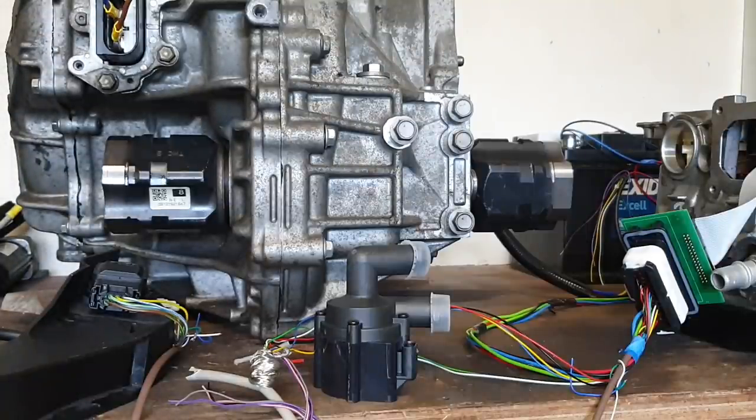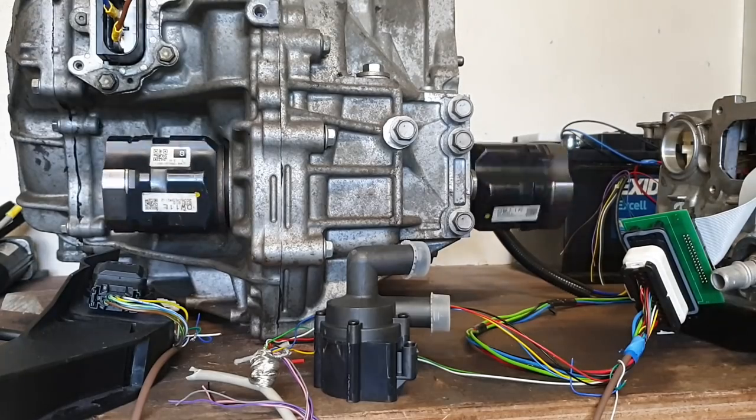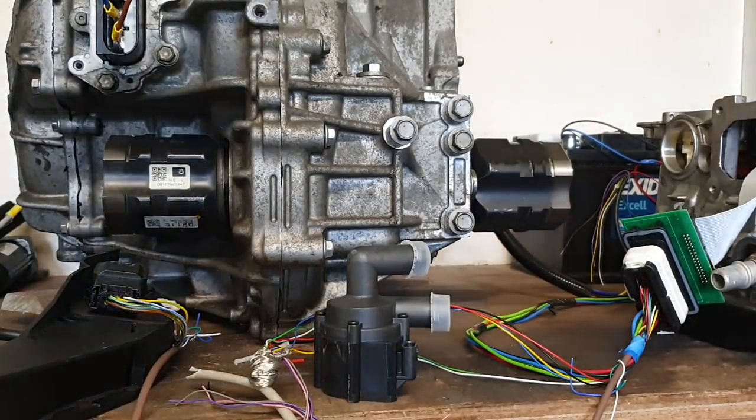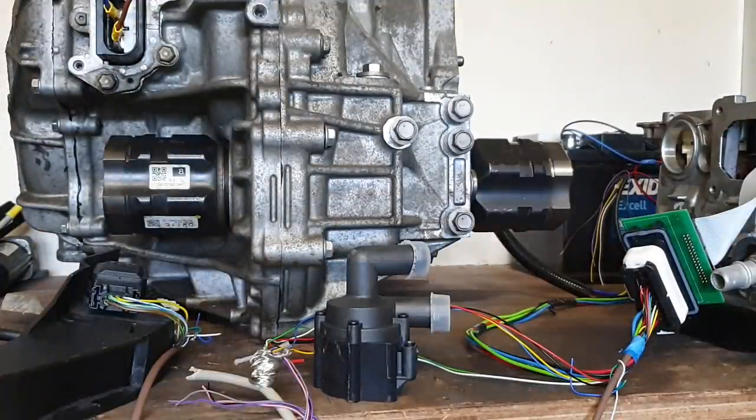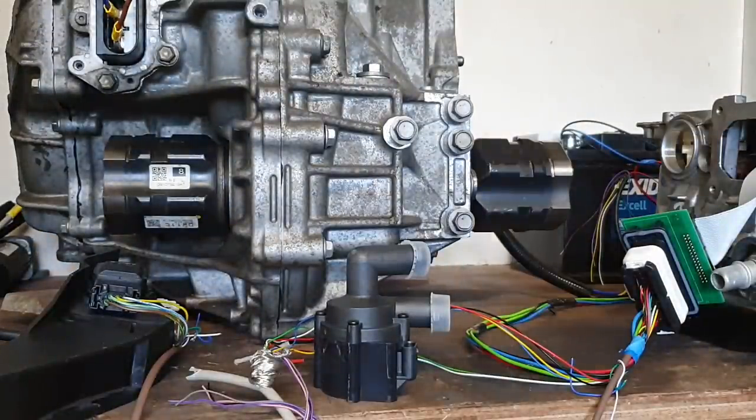So observe this, we got our 3 amps at 20,000, turns our shafts into drive position, so towards the wall from your perspective here. And if we were to go back to our original value here in our sync offset of 0, and back to our manual ID, what's going to happen here is our motor is going to turn in the other direction. So what we know now is that the value we're looking for is somewhere between 0 and 20,000. And what is the half of those values? It's 10,000. So 10,000 is pretty much almost exactly where we want to be, folks.